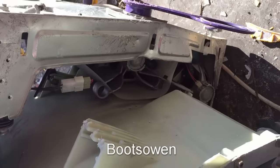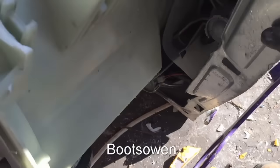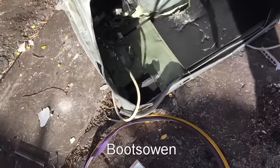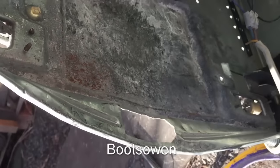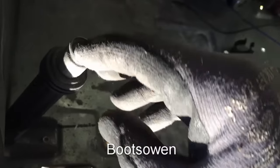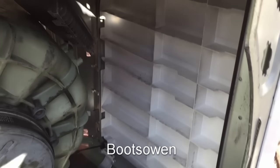There's the motors there, holding on. So we lost most of the fascia. Look at the buckle in the side of that. It's completely buckled off. Look at the battering this has taken here. It's all smashed up. Look at the underside of it, completely smashed up. That back lip there on the metal, look at it, it's pounded out of shape. That's where the motors have kept bashing away in there. Lost that sound insulation there. We haven't done so bad upside there. Lost all four shockers, they didn't just break, they completely snapped off. Normally these things just break off at the bottom or the top, but these just completely smashed off. Lost the suspension springs. They're lying on the floor around me.